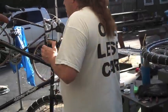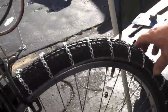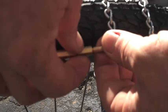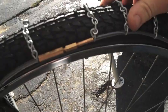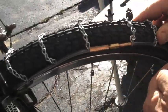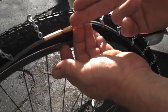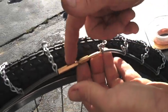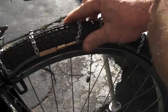They fit on with the turnbuckle. This one here is on wrong and I'll show you why. You can see how the turnbuckle unturns like that. So as the wheel is turning this way and it gets down towards the bottom, it's going to jam all the gook and the grime into the threads right in here. So it's on backwards — this has got to get turned around so that when it's going in the right direction, the stuff just slides off. I'll show you how that's done.